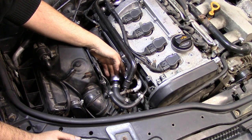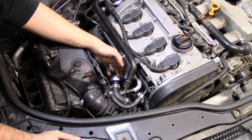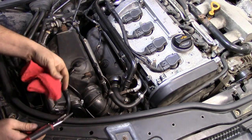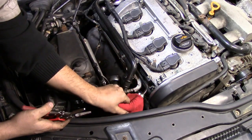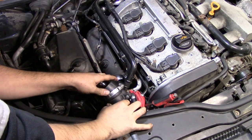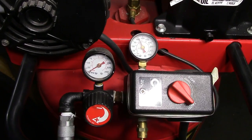I need to mention that I'm doing this for entertainment purposes only — this is not a proper way to do a boost leak test. You need professional equipment to do it properly, and if you do it my way there's a chance you could seriously get hurt. Next, we also need to block off this remaining hose — I'm going to use needle-nose pliers with a rag so I don't damage it. Finally, we insert our adapter and tighten the clamp down as much as we can.